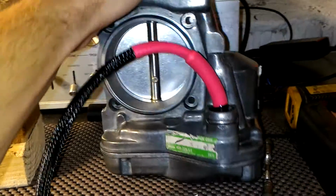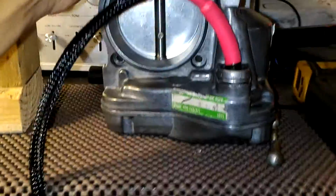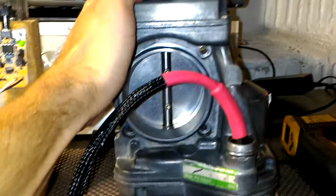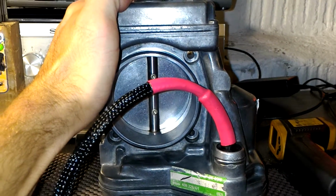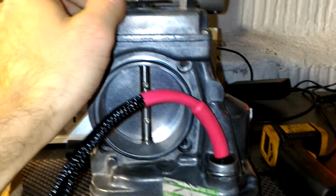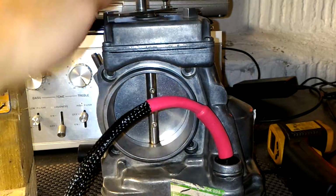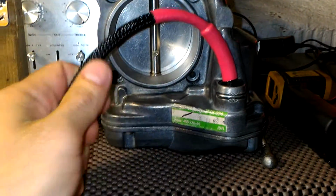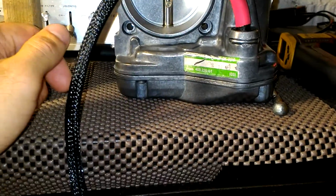So it's been energized for quite a long time now, about 2 or 3 days already, because I wanted to make sure the coil is very hot and works. And it is working just fine. The idle contact switch is good, you can hear a click, so that's working. Wires were really bad though, wires were all shorted out, so that was basically the problem with the unit.